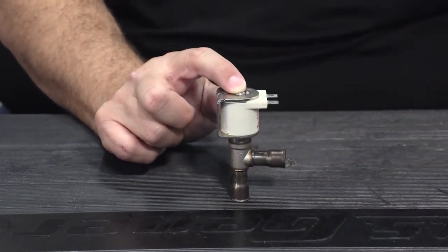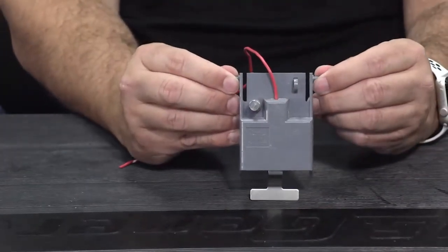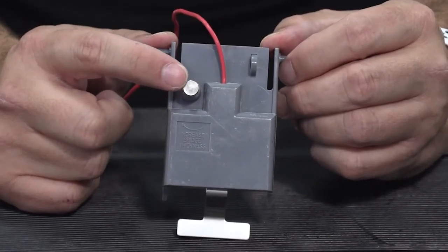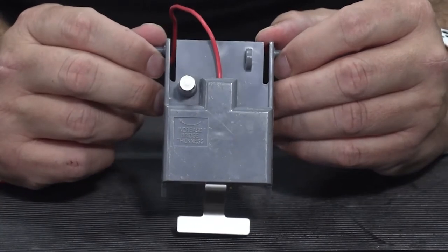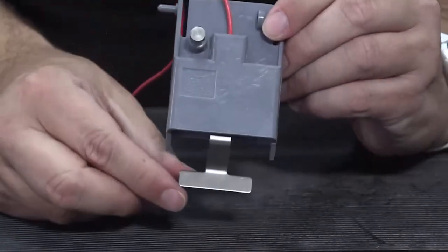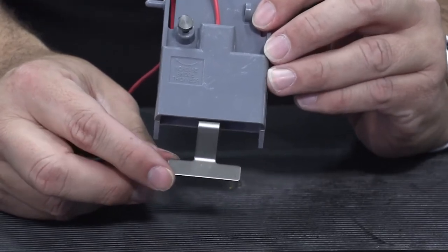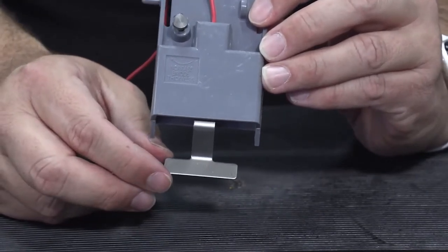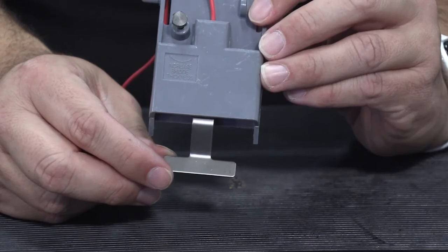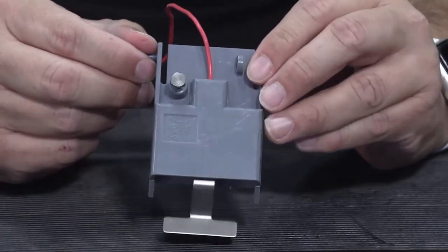Here's a nice zoom on the ice thickness probe. You can see there's an adjustment screw — as you turn it clockwise the probe moves further away from the grid, making the ice thicker. Counterclockwise gets it closer, making ice thinner. This metal T-part doesn't actually know the difference between water and ice. When water running over the top of the ice touches the probe non-stop for seven seconds, that puts it into harvest.